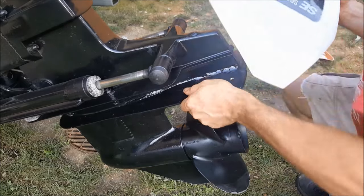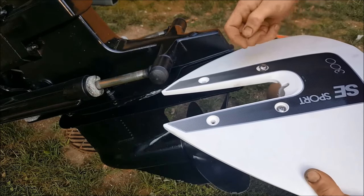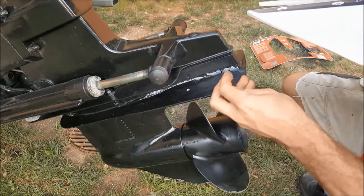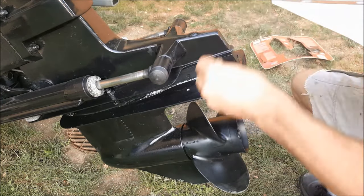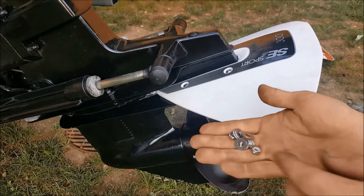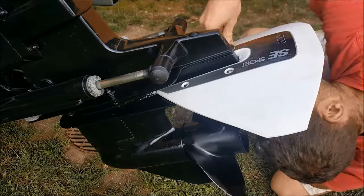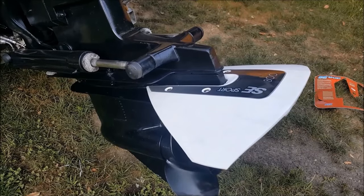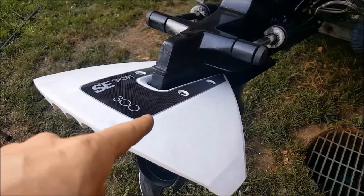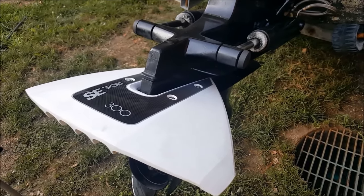With our holes drilled we're ready to install it. The longer bolts go in the rear. They say you can put the bolts in upwards or downwards — it doesn't really matter. The thicker washers go in the back and the thinner washers sit up front. Cool, they all lined up good. Now let's put our hardware on — bottom washer and then nut, snug those down. And there is the final installation. Nice, straight, and true. When you tighten these down you just snug them and then go an extra quarter turn to squish the rubber a little bit. Don't over-torque them.